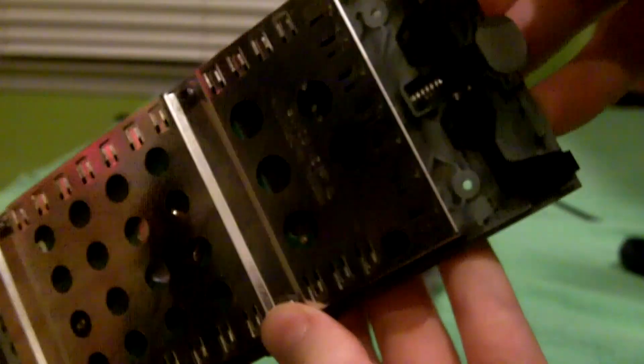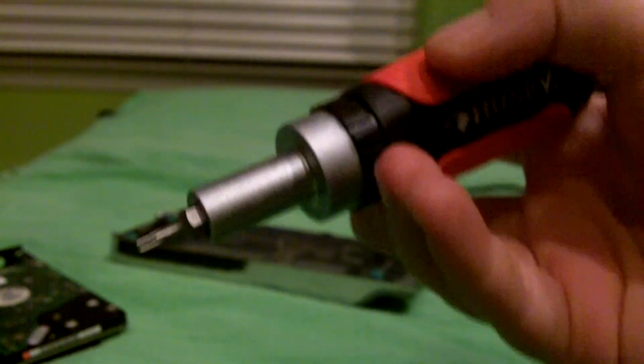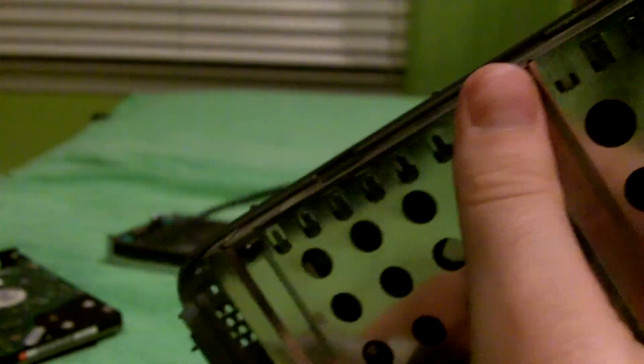Here's the inside of the hard drive. Don't move it around too much - make sure the springs don't get loose and the button stays on. This is where the Torx 10 comes in. All the screws on the inside plate you're going to need to take off - this screw, this screw, this screw, and this screw.